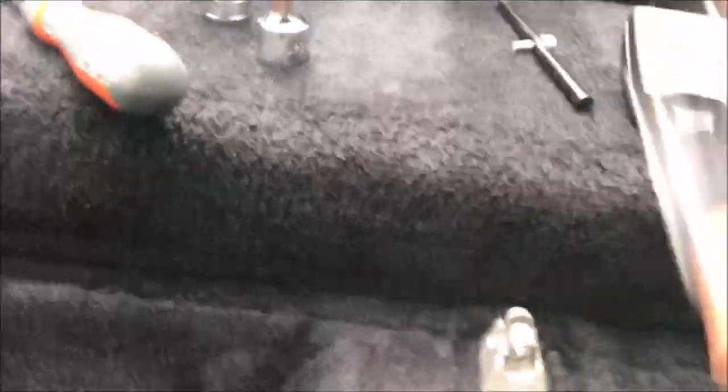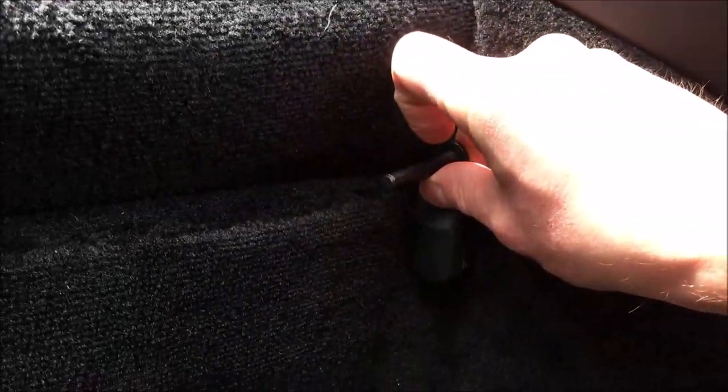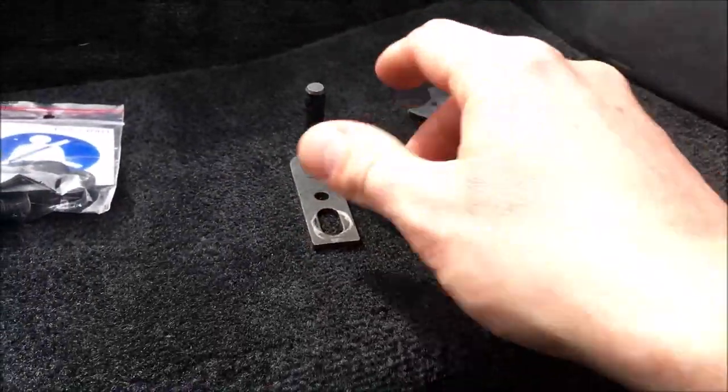Once all the seat belt buckle and bases are done, you've got the rear seat back. It has a black section in the middle and two bolts either side — that's how the seat is held. On each side there's a clip bolted in with a pin going into the side of the seat. Pry off the plastic cover — it just has a little tab going into a hole — and you'll be looking at the combined assembly where the spline bolt is. Release the spline bolt and it will come out, though the pin will still be sat in the seat. Repeat on the other side.